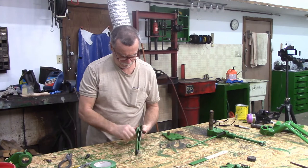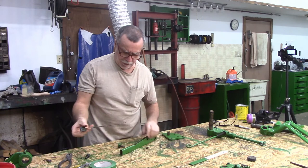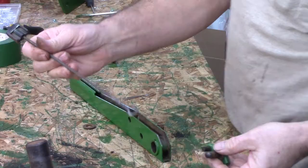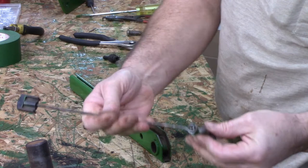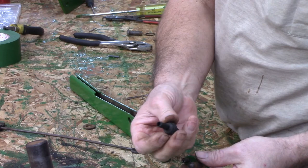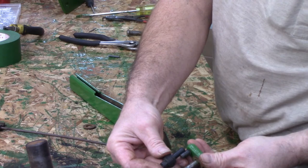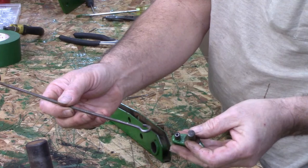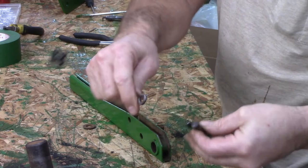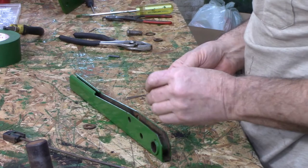A little dog, got the spring on there, take it all back out. The piece you press with your thumb went onto a roll pin on here and it had quite a bit of play. I actually found a plastic check valve - very, very hard plastic - it fit onto that worn-out roll pin really, really tight. Then what I did is I heated up this end with the torch and then used the center punch to actually expand it ever so slightly and then made it round again. And it actually fits pretty snug on there - works real, real good.